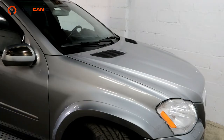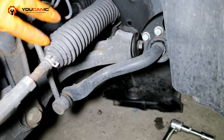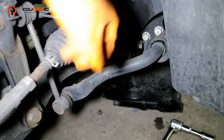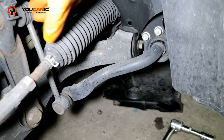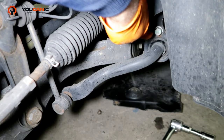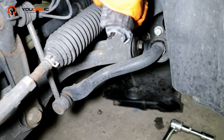Here is the sway bar — let's take a closer look at where they are, how they feel, and how to replace them. Right here you can see the sway bar, also sometimes called a torsion bar, and it goes all the way to the other side. Here we have the front right wheel, you can see the strut, and this is the sway bar link. This link also does wear out, so it's recommended to replace it at the same time, but these don't usually fail first. What usually fails is the sway bar bushing — you can see that the rubber is completely destroyed on the top. It's basically two of these: the upper one goes like this and it's totally destroyed there.